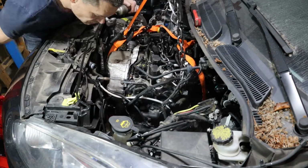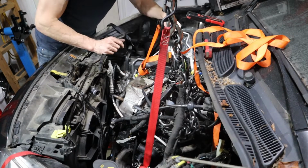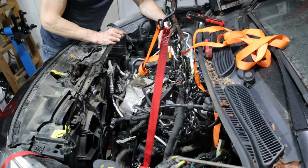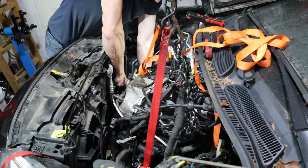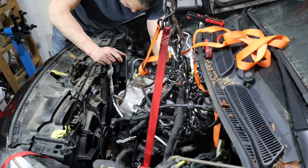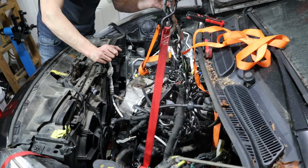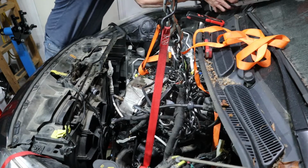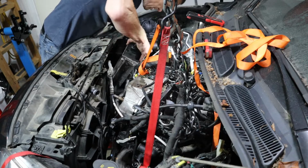Oh, something popped. Okay, I've been fighting to get this AC compressor from up here to down there for a long time. More straps, getting the engine angled correctly. Finally, I pulled out the charge air cooler because it's easy to pull out, and that's given me a little more room. And then, as you can see, now this AC pump is where it's supposed to be at the bottom of the engine. I figured I'd just show you the ending. Anyway, let's pop this charge cooler back in, for the second time in this video, of course.